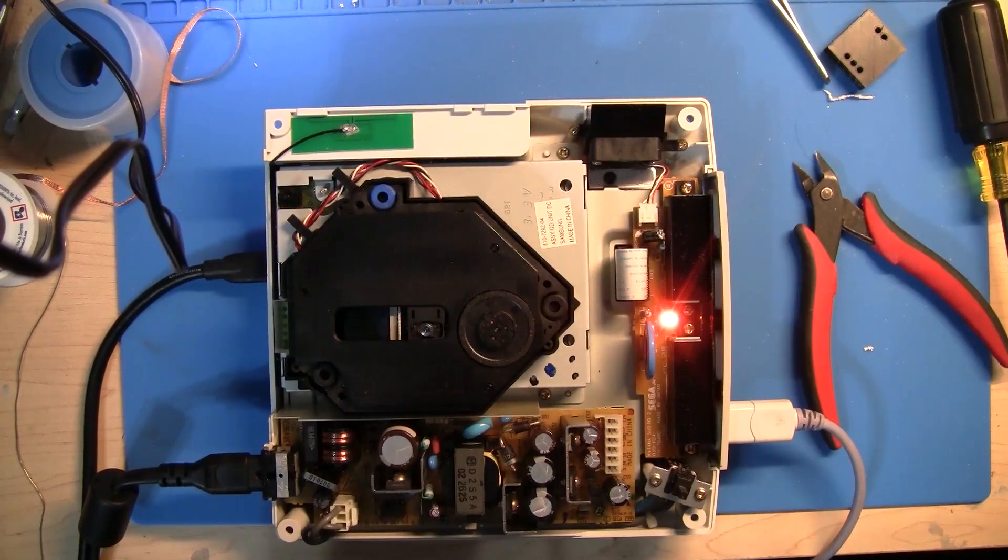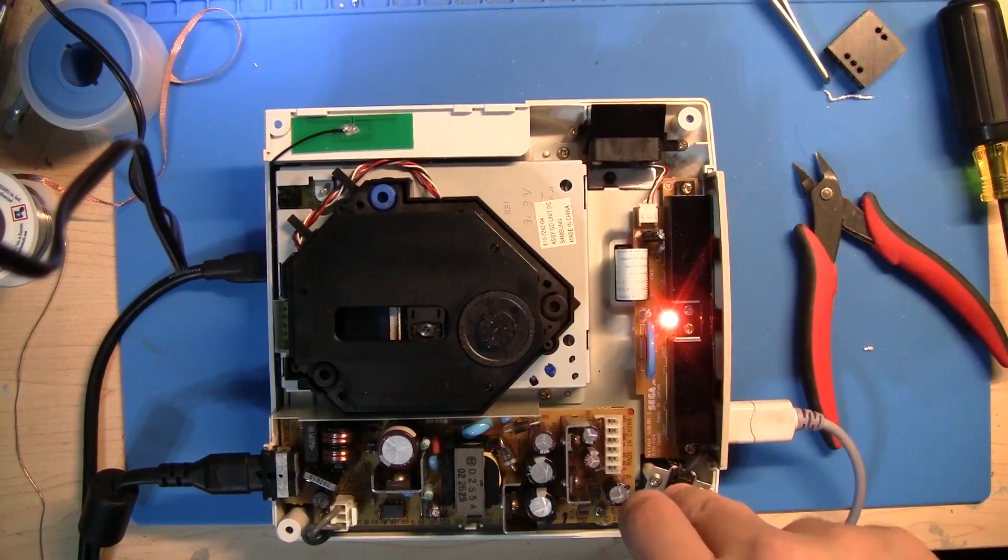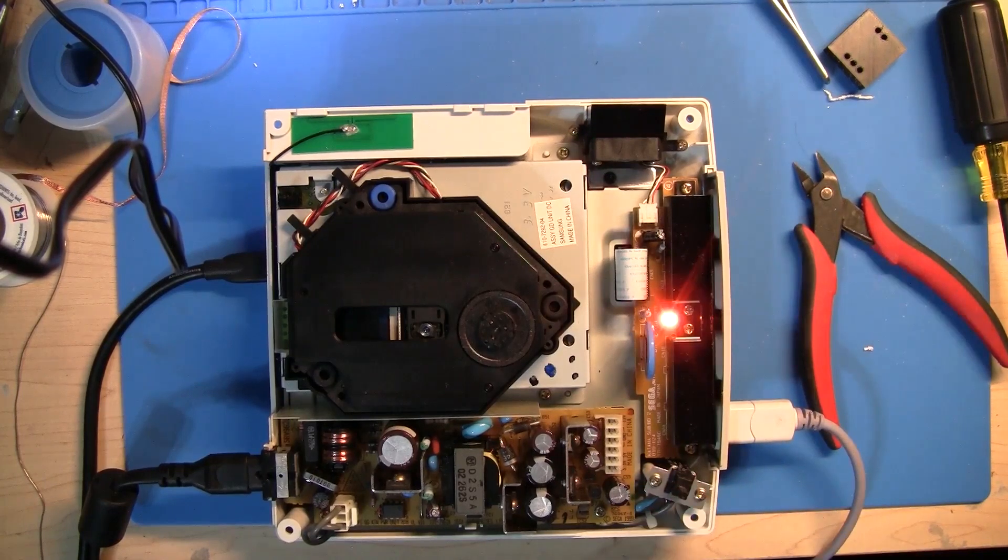Better reset the clock. At this point go ahead and test the controller or the on-screen display — hold down left trigger, right trigger, start, X, and A. I got the on-screen display up. I'm going to go ahead and switch the video mode settings to force VGA. It's going to ask me to reset. The Dreamcast should reset. The Vizio TV is going to show an invalid format, but that's just because it's a dumb Vizio TV. I'm going to turn the console off and back on. Now I've got a solid 480p signal. I'm going to open OSD again, go to 1080p — and I like that setting.